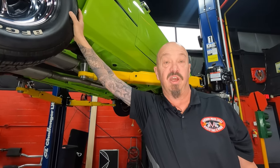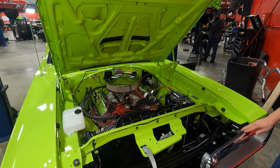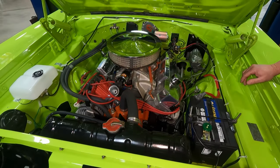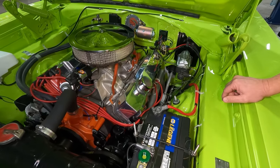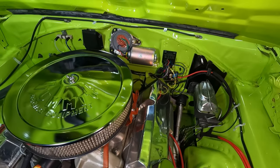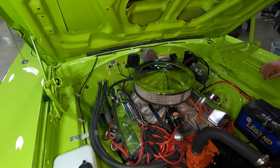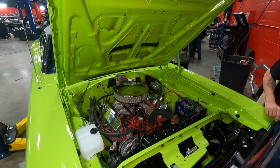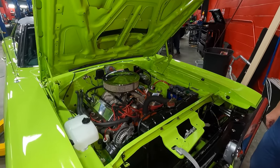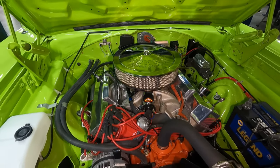Let's lower this baby down and look at that 440 under the hood. Alright, under the hood here we've got 440 power — looking sweet, man. Look at those valve covers. Those are sheet metal valve covers. Got some great looking TIG welds on them. Looks like we've got Hooker headers on there. We do have manual brakes on this car. It does have power steering. You can see the firewall is all nicely painted. Looks like the windshield wiper motor is new, and it looks like all the wiring harnesses are new. Bottom side of the hood is nicely painted. There is an Edelbrock intake on it. We do have aluminum heads on this one. We do have a Holley 4-barrel sitting up on top. Everything on this thing is looking sweet, man. The block is nicely painted. The block was cast in '67.